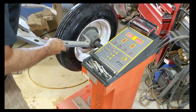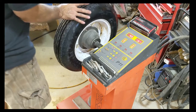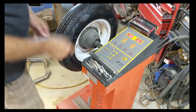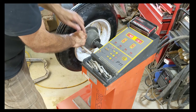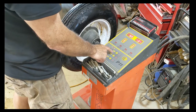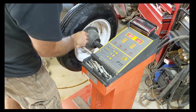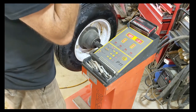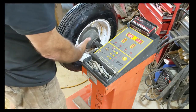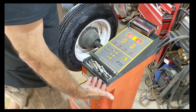This little device measures the distance out from the machine, and that's what we're setting here. It says ten and a half. So up here to ten and a half. Double check — yep, ten and a half out. I know it's a twelve-inch tire, so the setting D is the height of the tire — and it's the rim size you go off of. So I'll put it back to twelve. Now this is set up to do a spin. With this spinner, you just take it by hand until the lights go out, then let it go.